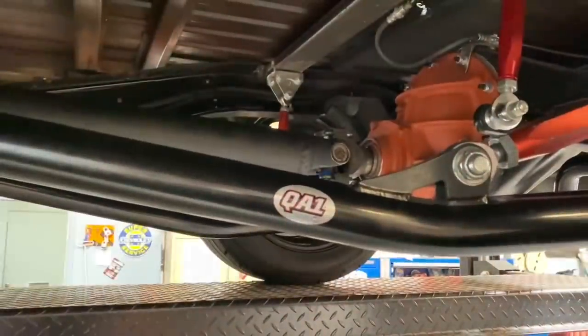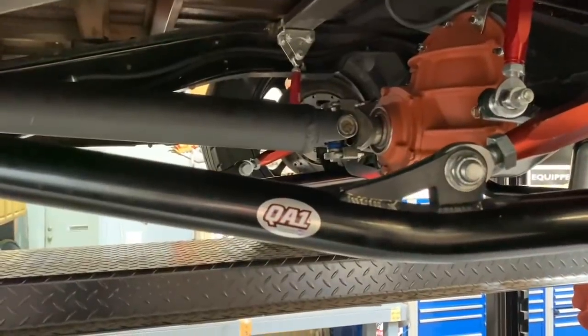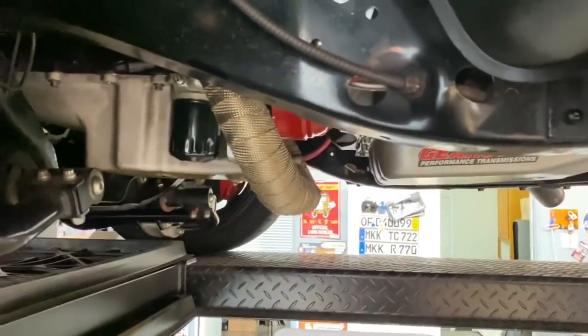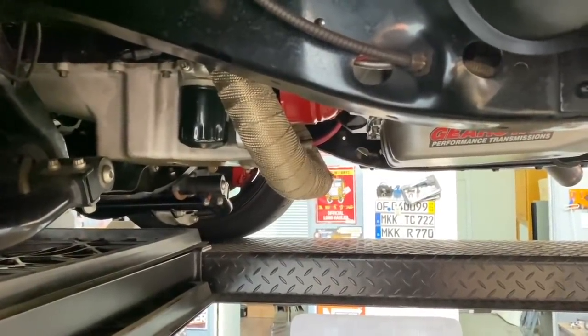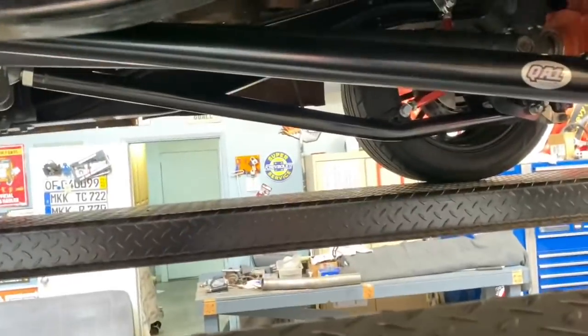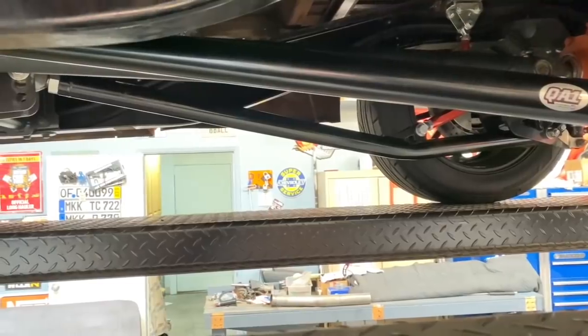You cannot make the rear pinion go up ever, according to David Freiberger and everybody else on the planet. So I put the rear pinion a little bit down, and now you can see it right there, a couple, 2 or 3 degrees down. The problem is the front pinion is still zero, because the crank and output of the transmission is down 2.40 degrees. I put this thing down, and I can't have them both going down. That creates a vibration, a hideous vibration.